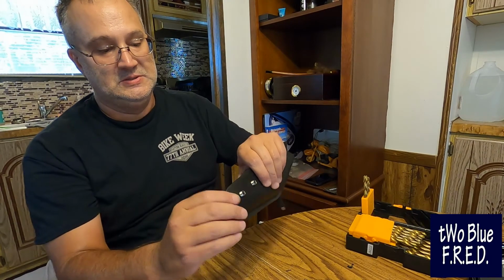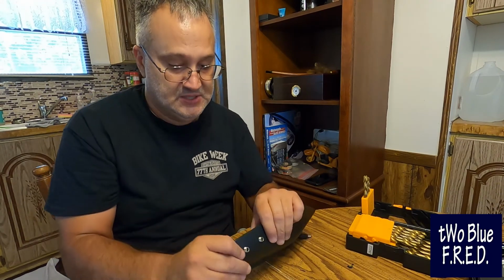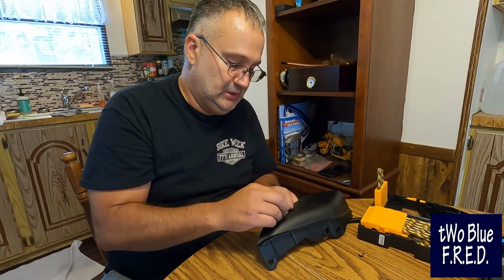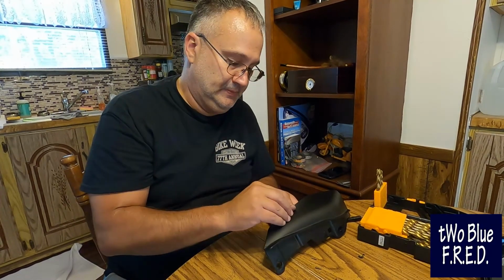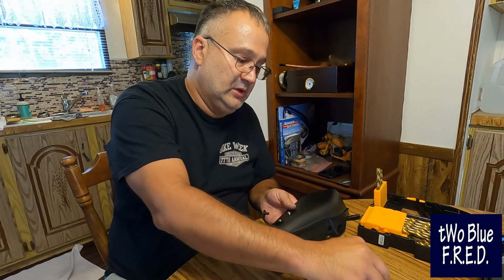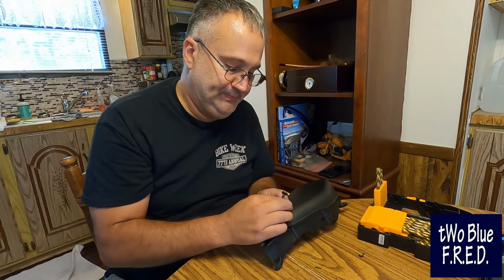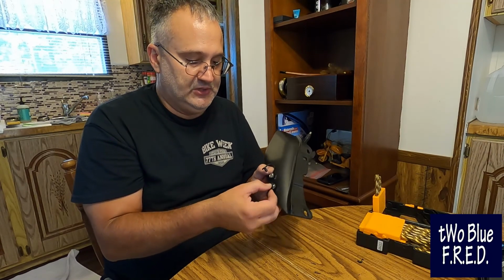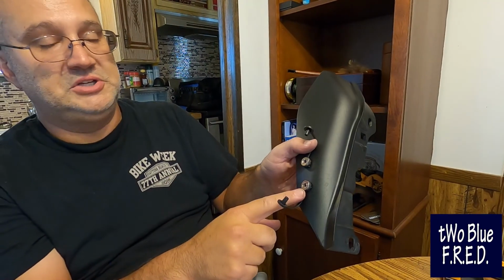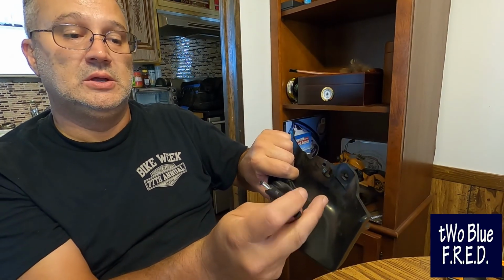Do the other one. Now these things have a little screw on the back side that you can use to tighten them up. This Gerbing setup is really pretty nice. Truly it is. I used it on the Goldwing, and it was really good. You got a little lock washer. You've got this little cap cover to protect the plug from, you know, moisture or whatever. And then you've got this little screw that you tighten up just like that. We're gonna have to fix those a little bit, but just like that. You got one for your jacket and your gloves, you got one for your pants and your socks, and then these two connectors will plug into the part that's underneath the seat.